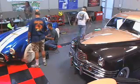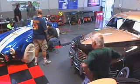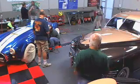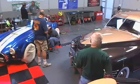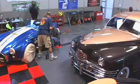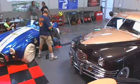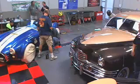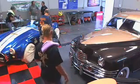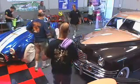No? I have an article that's probably about 6 years old on the Meguiar's forum where a guy brought down that same Mustang, and it's got the flat black louvers and the flat black stripe, and those were all dull and ugly looking. We polished the paint out, and then I showed people how to polish out flat black. I put a tape line down the louvers, and I only polished out one half, and then I took a picture. One side's crystal clear, dark black, but not shiny, just dark matte satin black. The other side, you can tell how dull it is. So there's a little technique for doing that kind of stuff. Not a wax. You have to use different products for that.